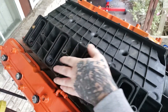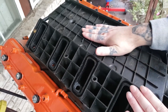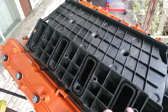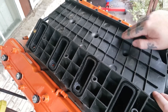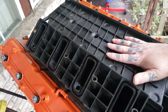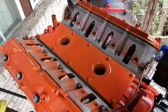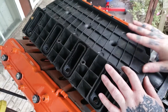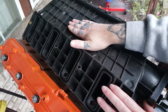You can see, unlike the LS1 intake shown in the photo, this bottom is completely flat. You can't use it because your steam vents are hitting these little notches and lines here. So what you want to do — and I'm not going to do it to this one because it just has the single vent tube on the front, factory 5.3 — is take a grinder or some sandpaper and sand these completely smooth.